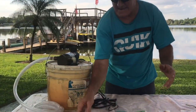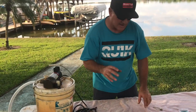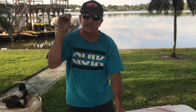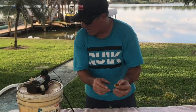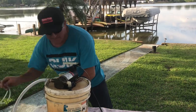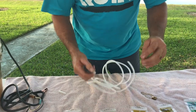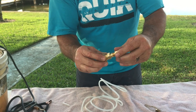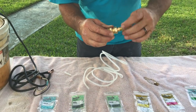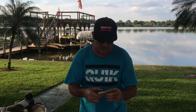When I'm done, I unthread the garden hose fitting, leave the hose sitting upright in the boat, and take my PVC cap — it has a garden hose thread on one side and a machine thread with an end cap on the other — and thread it right into the garden hose fitting so I can set it down inside the boat and it won't leak. For the 190, where I'm sucking out through the dipstick tube using the ice maker hose, I go to a quarter-inch nipple that fits the water feed hose, hose-clamp it on, and that quarter-inch thread connects directly to the same fittings.